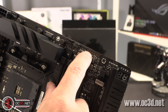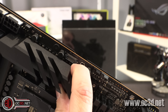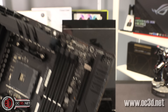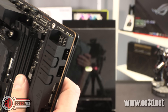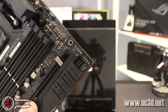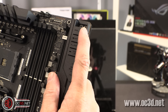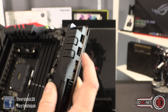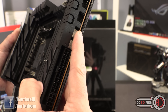Up here you can see the voltage readout point. There's a water block sensor there for if you buy an aftermarket co-branded water block — I think EK and Bits Power definitely do them. There's a POST reader up here — they call it the Q code. And you can also see just there those are your boot lights, so it will say like CPU, memory, GPU, and then POST or boot. Then you have a start button and a flex key button. There's no reset button, but that is a rad fan header, and that one is a water pump fan.